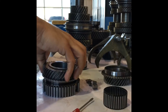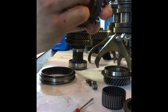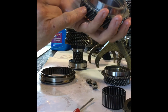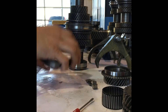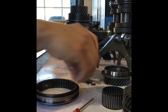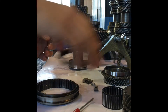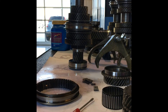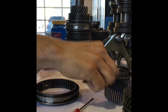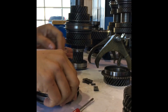You always want to make sure all that stuff is in good shape — no marks, always inspect the teeth. These teeth here are in pretty good shape. These are cryo-treated from P-Works, so they should be able to hold up a little bit stronger than OEM parts because of the hot-and-cold treatment process that strengthens the metal. I think that pretty much covers the inspection.